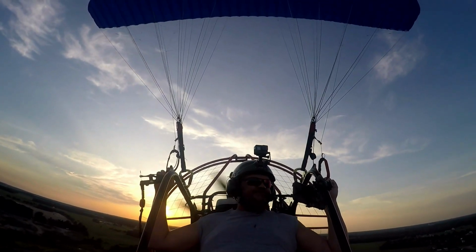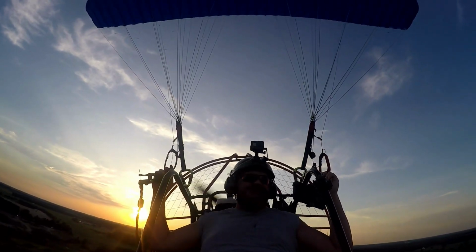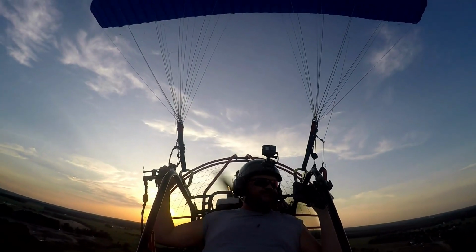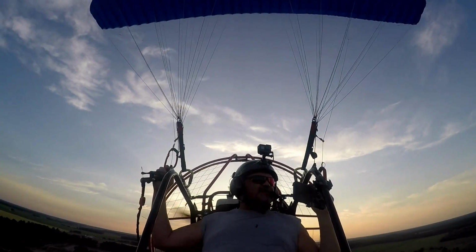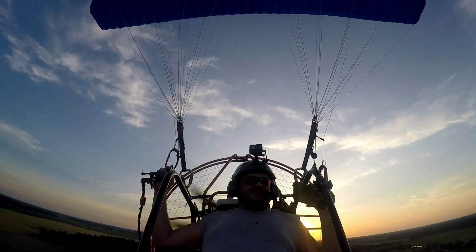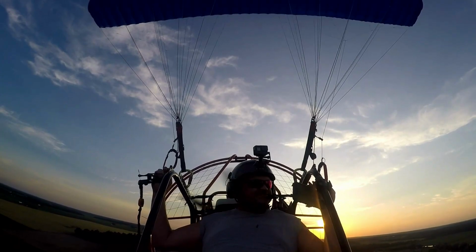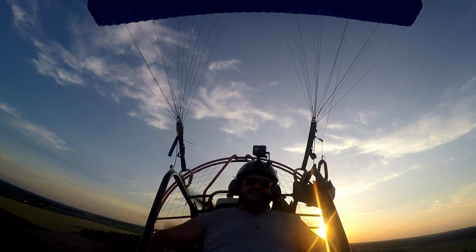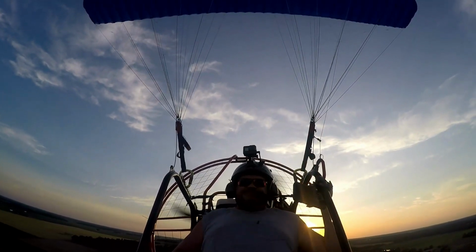I changed the jet inside of it. Went to a 155 instead of a 160. Seems to have a little more climb. I think I was talking to Chris at Southern Skies down there, and he was telling me that it sounded like it was running rich as well. So I got rid of the 160 jet.